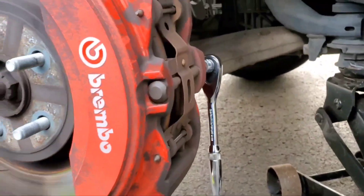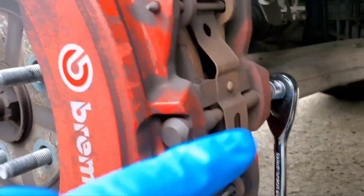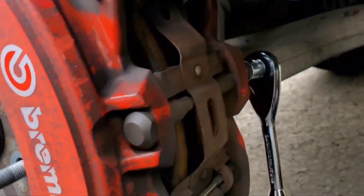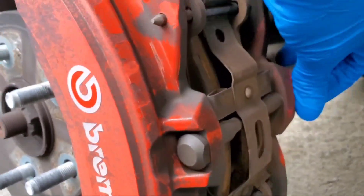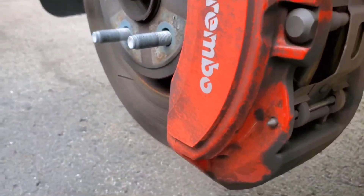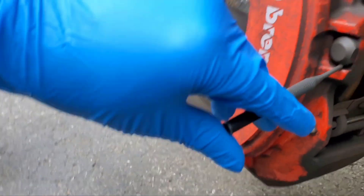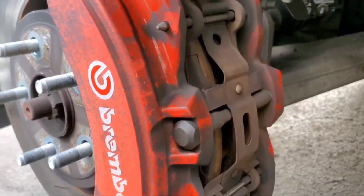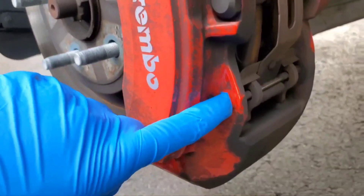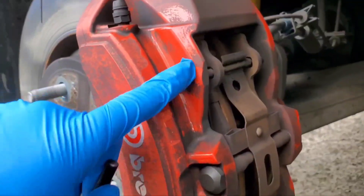I'm already getting ready to have this bolt off right here. If anybody don't know how to do this, it's super simple. One bolt, back here in the back — 13mm socket. All right, I'm going to loosen it. Bam, just that. Now you need to get a pin punch — you're going to need a big one and a small one. Got to punch this out from this way, and these little punches down here. One, two — so all three of these got to get punched out, man.